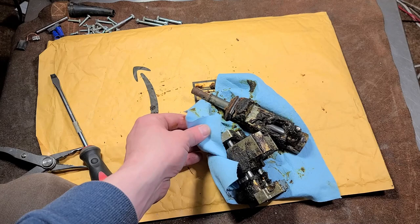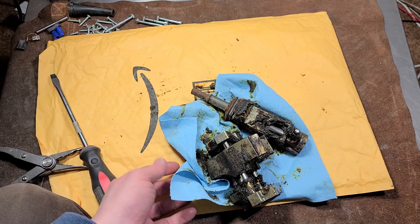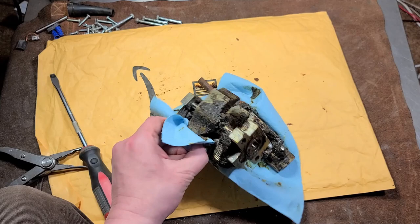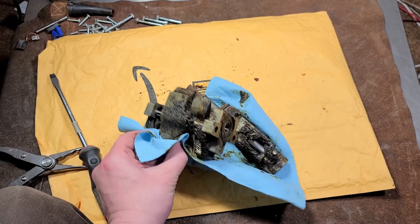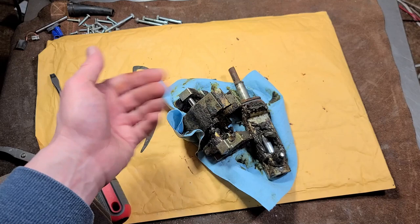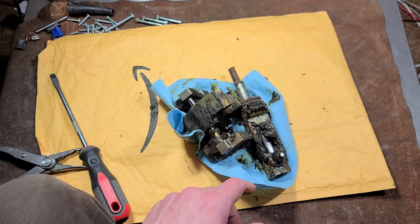It's American-made with German engineers, so it really isn't too bad — they just missed the mark in just a few areas. One of them was this whole counterweight mechanism. This counterweight is probably three to five pounds of steel — hugely heavy. The issue is because you have so much mass in the reciprocating rod, the lighter the rod is, the less counterweight mass you need for it. So this whole pin-and-socket system makes more weight, and then when you have a counterweight, you have to double that.